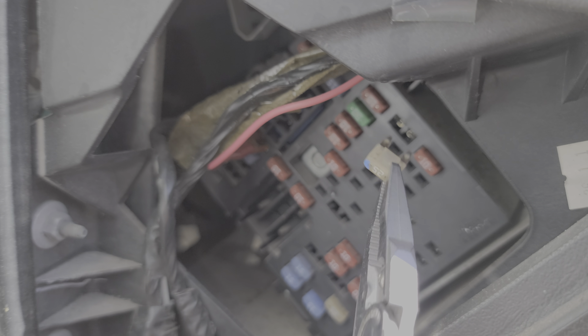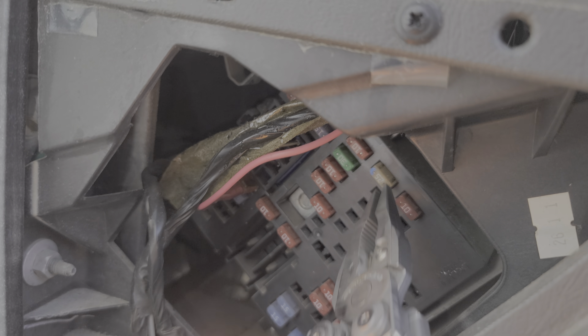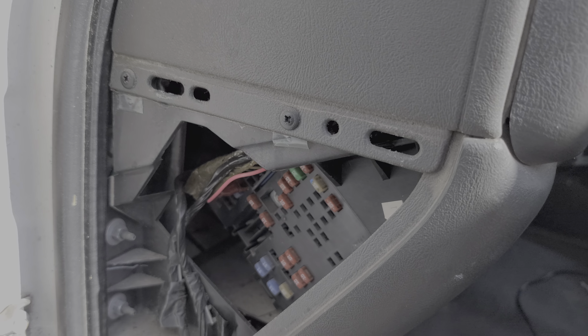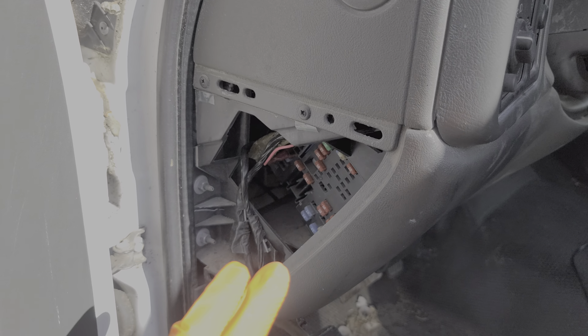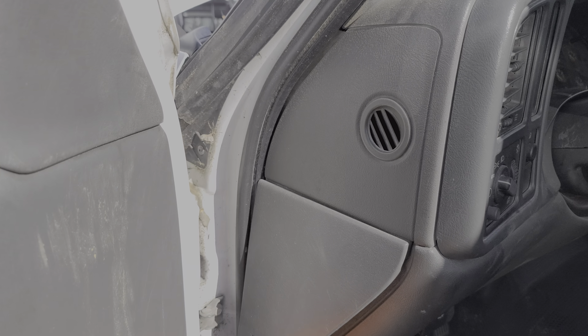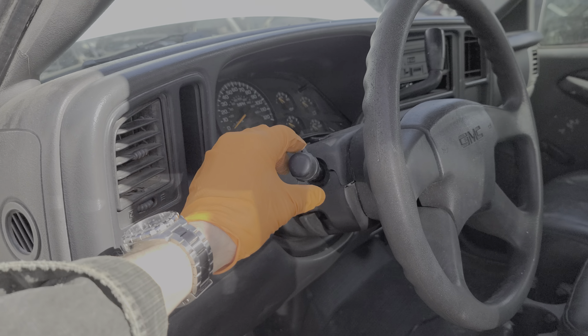As you can see, this is what a good fuse looks like. The windshield wiper motor has a computer built into it, and that computer is also powered by that 25 amp fuse. The computer is what directly communicates with your switch.